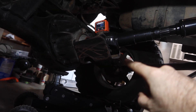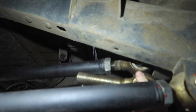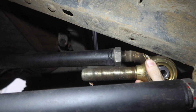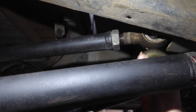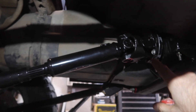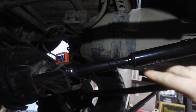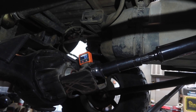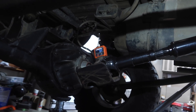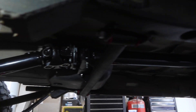There's way more clearance underneath here, which is good. I checked the enduro joints from Barnes 4WD — more than half the thread is still inside the tube, so I'm not worried about going too far on the threads. I need to check to make sure at full droop it doesn't bind up, and flex the suspension up and down to make sure the coil springs are going to be okay. Then I'll take all my final measurements and show exactly how much extra clearance I've gained from installing this two-piece driveshaft.